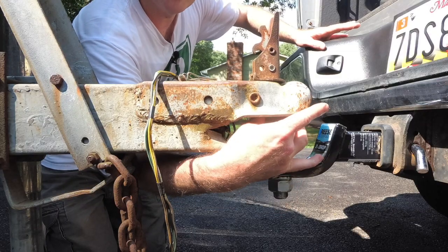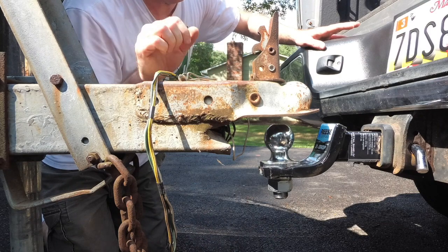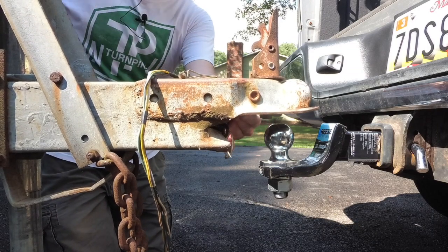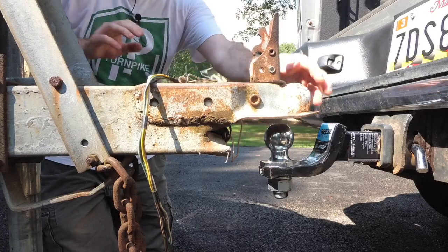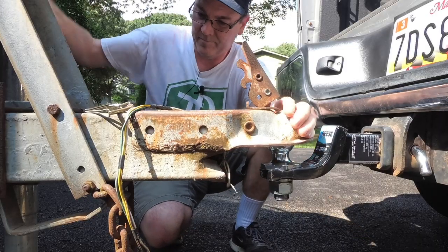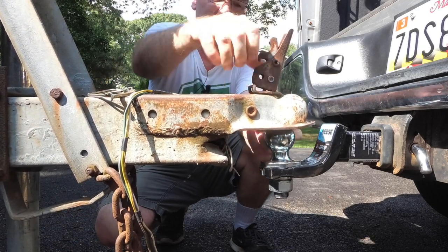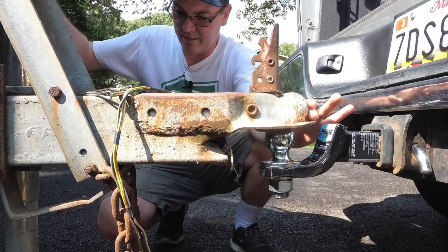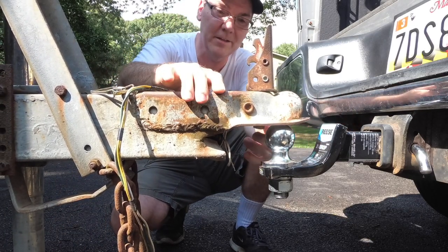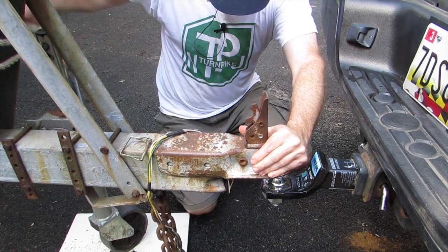As you can see, we're not perfectly lined up here. If we're not perfectly lined up, the tab on the inside of this will actually catch on the ball. So as we're putting it down, we're going to need to wiggle this back a little bit. Also, you'll want to adjust the height of your trailer as you're doing this to make sure the ball can clear the receiver. I had mine set high enough. You can hear that — that was the latching piece bumping on the ball, doing what it's not supposed to do. So I'm going to move the truck forward just a tad — by doing that it should drop correctly onto the ball now.